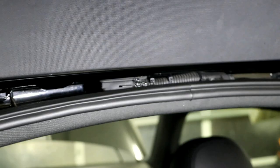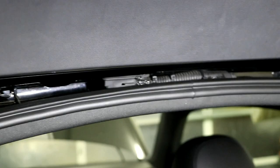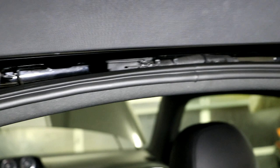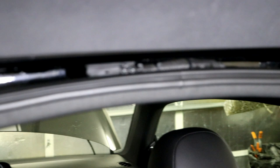In the instructions with the kit that you get, you can get it on the internet, on their website, the kit instructions said that the grommets were over here. So I don't know what car they used, if they used a Beetle or what, but here on a 2015, the cables, wiring, everything goes through these two grommets here in that hose. So if you guys were wondering how you do that, on this second part, it's here, the clip.